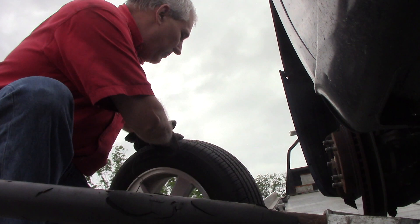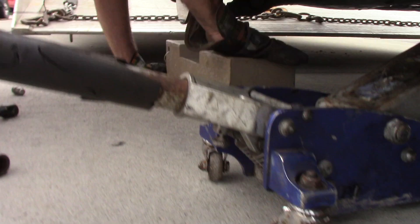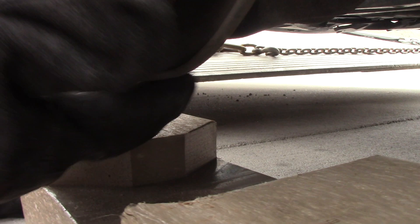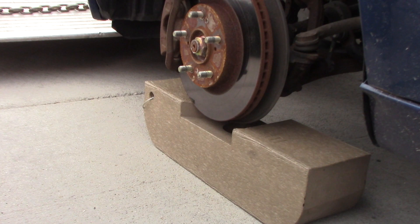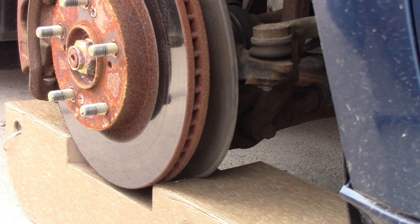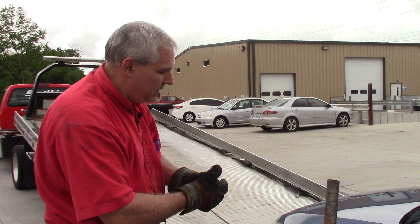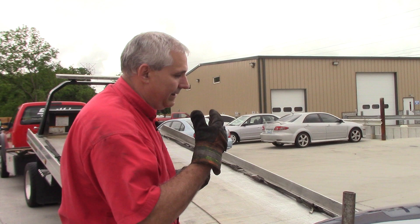So that's got the tire off. This also works for broken ball joints. This is your control arm, and this is your ball joint right here — that's what comes out. This piece right here, that's your ball joint. So we want to get that positioned in there, and it looks like we're pretty much where we need to be. Now we'll let the car down. I will be honest — we're doing this with a car that doesn't have an actual broken ball joint. So it actually makes demonstrating this a lot harder, because when it's actually broken, you would be setting right there on the end of the control arm where the ball joint sets, and the rotor and everything would be out of your way because it's disconnected. So it actually makes it easier when it's actually apart than demonstrating it with a good car.